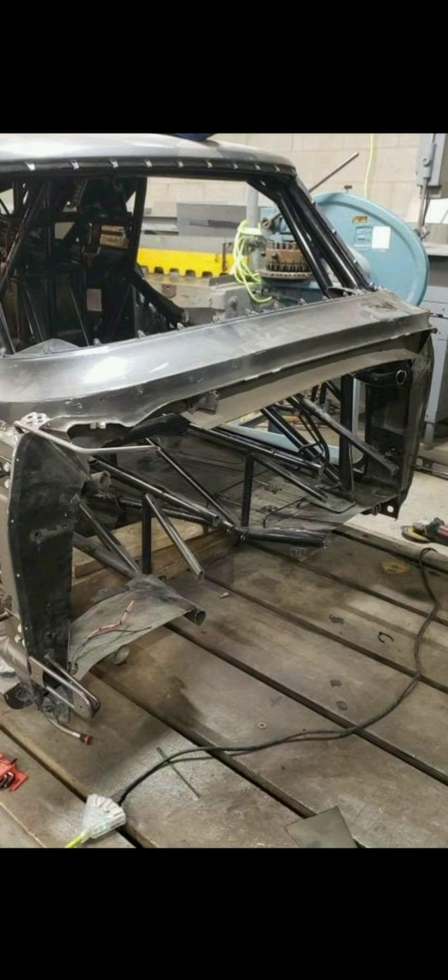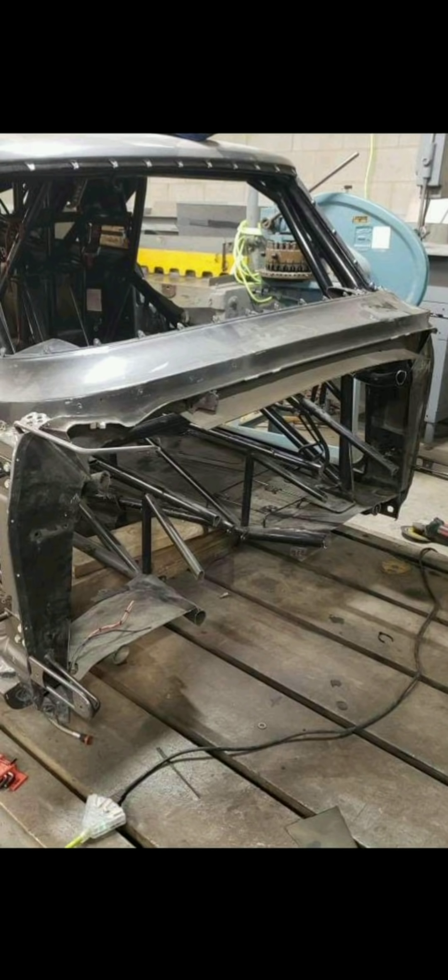He's apparently front-halfing the whole front of the car. The other thing with the 63 Chevy IIs is they have a very short nose, so if he is going to a pro-charger setup, a big blower is actually going to go through the front of the car. He intended to put the bigger pro-charger back when he was pro-charged two years ago, but the bigger blower did not fit. So by moving the firewall back and putting the engine a little bit back into the chassis, you will be allowed to actually put the pro-charger with no problems. So let's stay tuned for any more updates real soon.